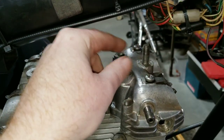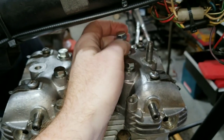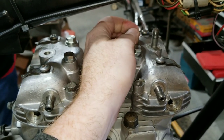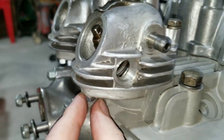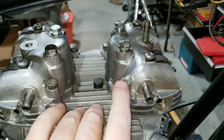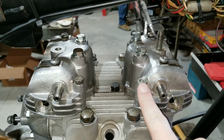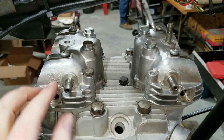After we get all these bolts tightened down, we'll go over torquing them. These actually get a foot pound setting. Some of these nuts we can't get to with a socket so we'll have to tighten them up by feel. The quarter inch nuts would probably be inch pounds anyway. Looking through the book, I know I saw this one was like 10 foot pounds. The quarter inch bolts — I think seven foot pounds, but I'll verify. Going forward, coming up in a few more clips we'll be going over setting the valve clearance between the rocker adjustment and the valve, then putting the head steady on.